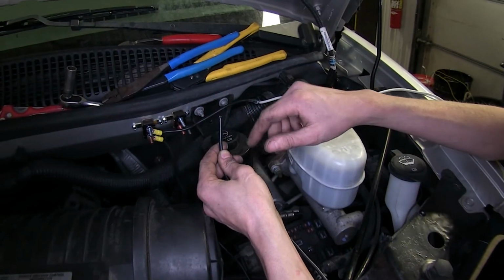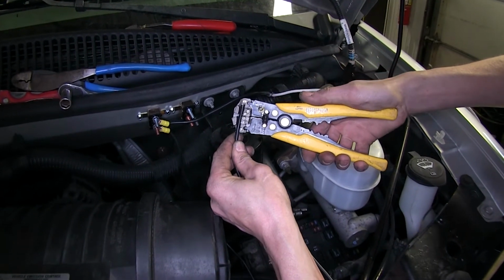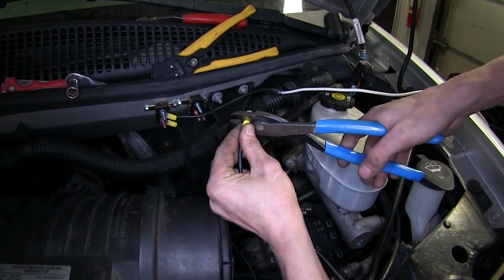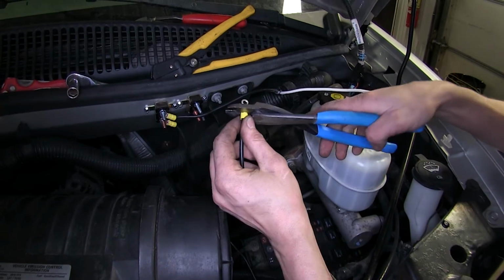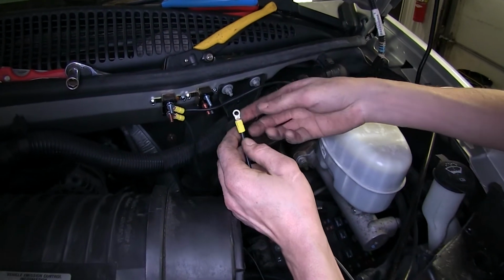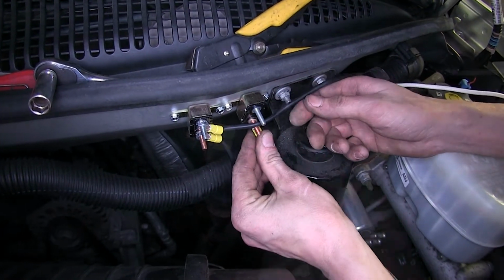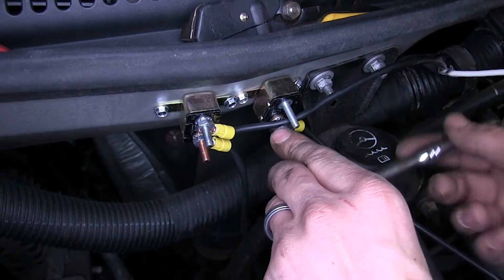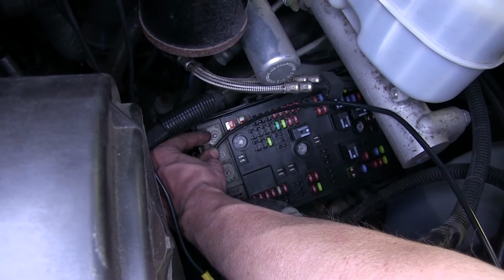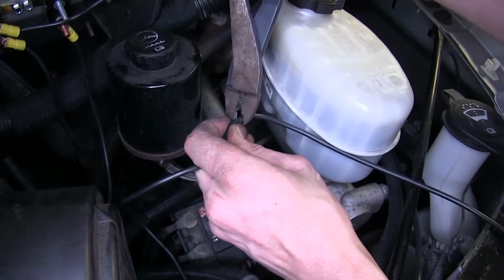Now on our leftover black wire that we have, we'll strip off the insulation on one end, and we'll attach another small ring terminal, and we'll stick this on the copper color side of our 30 amp breaker, placing on a nut, and we'll tighten that down. Now we'll measure off how much we're gonna need of that wire to connect to the same stud as we are for the other breaker. And we'll cut off the excess.